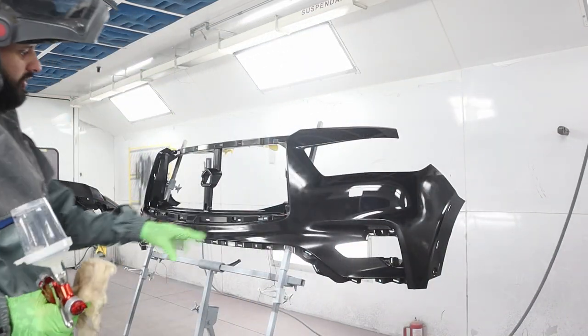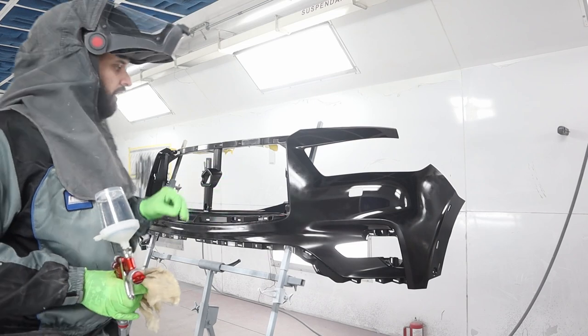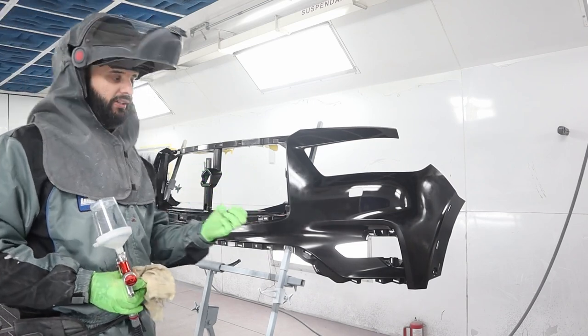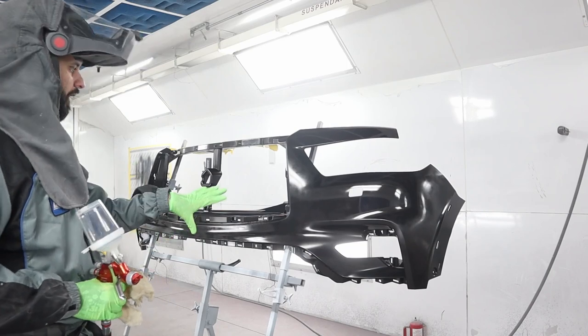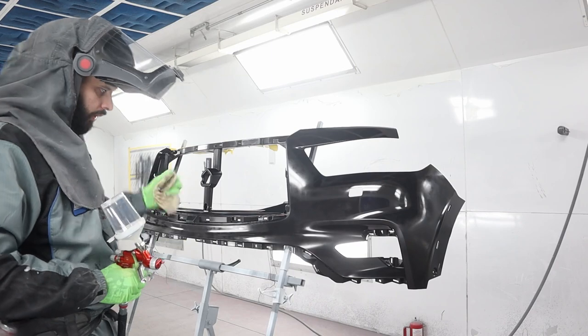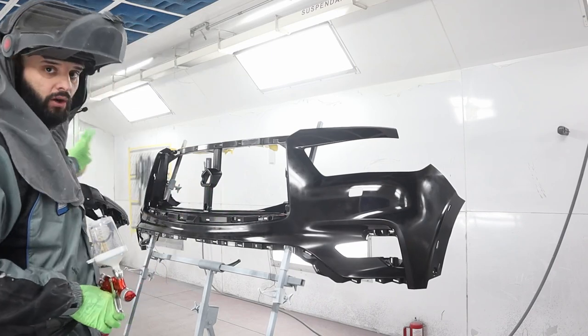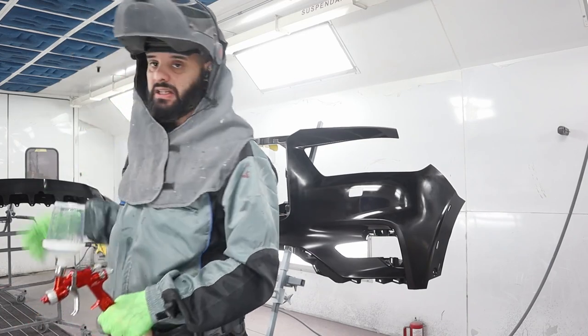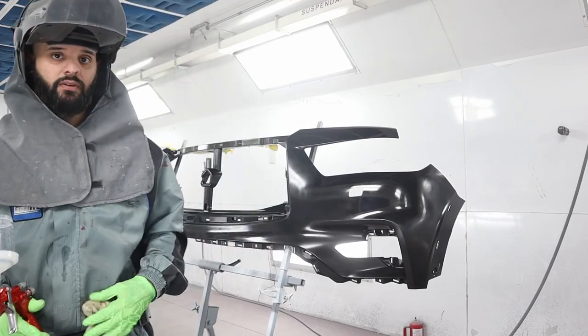Once this flashes, you'll see that this cover is shiny — that's okay, that means the plastic adhesion promoter is doing its job. I'm going to let this dry for five to ten minutes. Once it's good and flashed off, I'm ready to seal it. I'll do the lower cover next and give it its proper time, and then we'll get in here and seal this stuff.